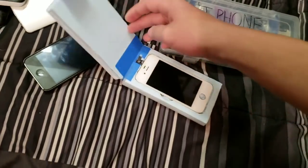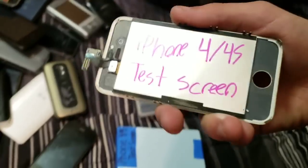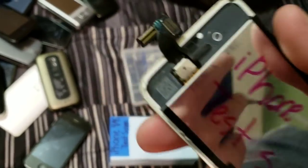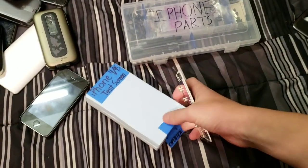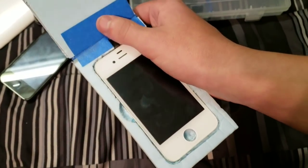I keep it in here as a test screen, in case I get an iPhone that doesn't have a screen and I want to test it. I wrote it down right here, and essentially I superglued these connectors like this — you can see that one's lifted because I had to do that. But they set down perfectly onto the motherboard and the screen fully works. I thought it would be kind of cool to make something like this to protect it, and it does — just sets in right there, and then I have a little thing to lift it out.